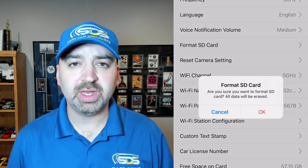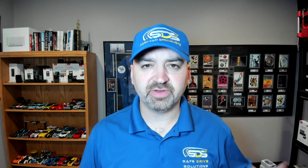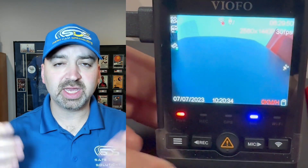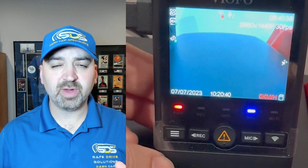Number three: format the micro SD card. Sometimes your SD card gets completely filled and you need to format it. For instance, if your locked files take up around 60% of your recordings, the SD card runs out of space for looped recordings. On a Viofo dash camera, locked files are 100% locked and won't be overwritten. On a Viofo A139 Pro, push and hold the REC button for about five seconds to format the micro SD card. Check the support tab on the Viofo website for specific instructions for your model.